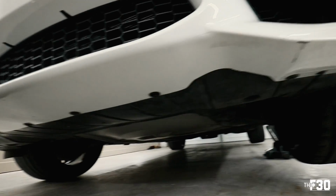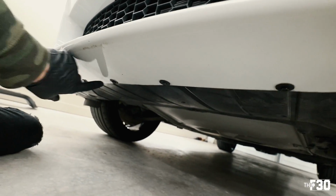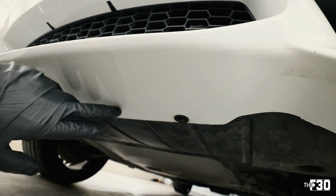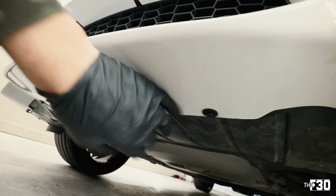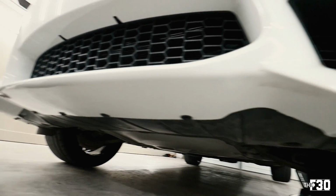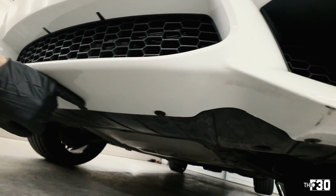All right, so I just hit it with some isopropyl, and we're gonna be taking out this guy, a bunch of 8 mils. Once we get it adhered to the actual bumper, then I can start drilling for the actual bolts. Then I'll put the bolts through and sneak my hand back here once all this is dropped and tighten them down. So that'll be good. I think that we're probably just gonna do 3 actual bolts, and then I'll stick to self-tapping screws for everything else.